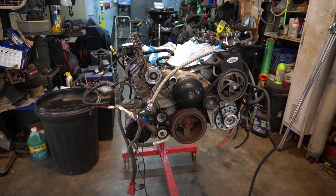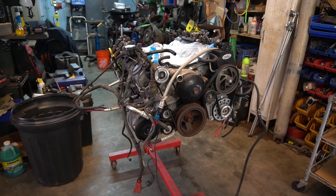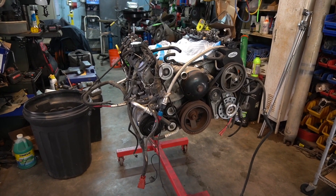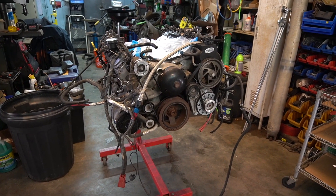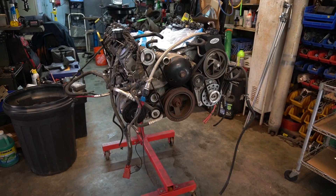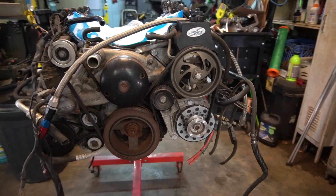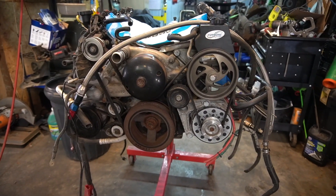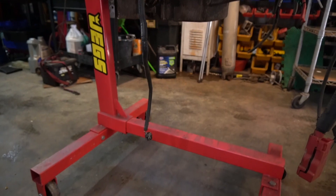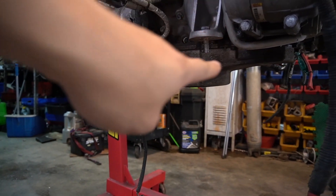That's why I went with this engine — it was cheap at $3,000. For me to source out all the parts on the original engine would have taken time and a lot more money. So I'm just going to tear it back down, put fresh new seals on it, and see what cam is in there. It looks like a pretty big cam from what I've seen in the valley, and I want to know its lift and duration.